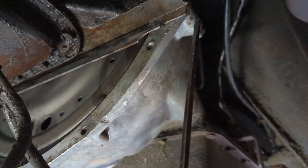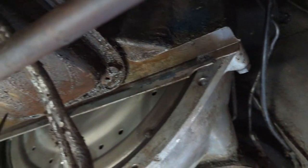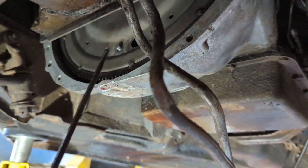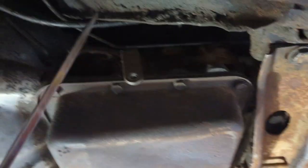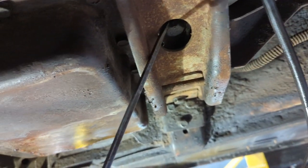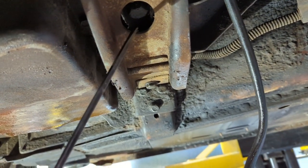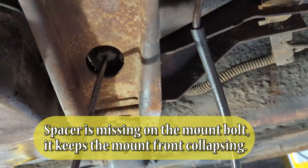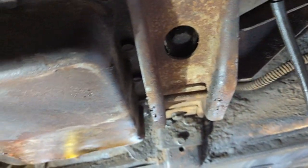You don't want to break one of these off — there are pins on this one, one up in here and one up on the other corner at the top. If you've got to crank the bolts in to pull the transmission tight, that's not the way to do it. The linkage still needs to be cleaned up and put on. One difference: the mounting bracket spacing — the space between the rear mount transmission bolts is wider on the Cruise-O-Matic than the C6, so that's something you might run into.